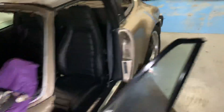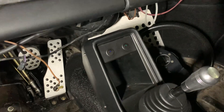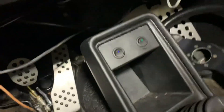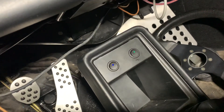What we did that was kind of neat to make that thing switched — we have it so that the center console had two holes in there for AC, which we did away with. So what we have here are just two switches, and they are relatively small so they can't carry the current, so we ended up just using them as the trigger.